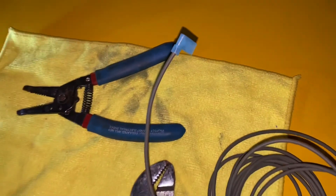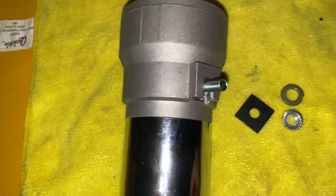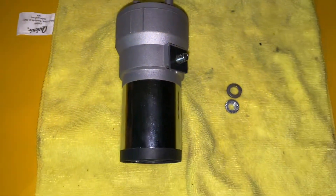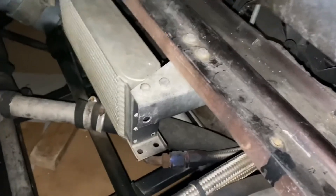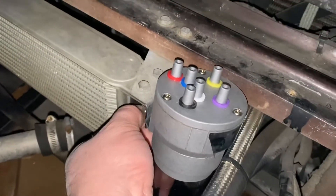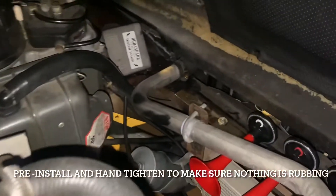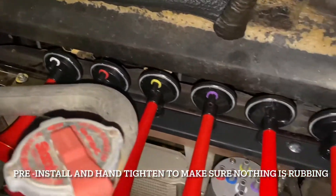Moving to our air compressor — on the bottom of that compressor you're gonna have to splice and attach wires to the proper terminals. To hang the air compressor, put the bolt through the rubber gasket, find your mounting point, and secure it with the lock nut and washer. I mount mine on the side of my oil cooler. Keep in mind it has to be mounted vertically, and that's why you wire it before you hang it — it's just easier in the long run.